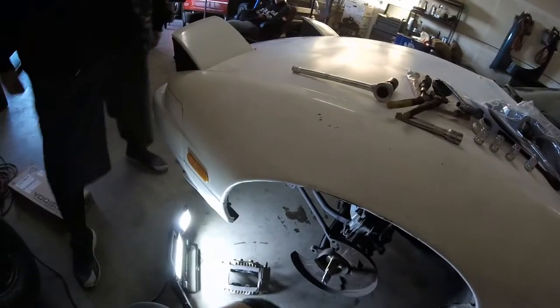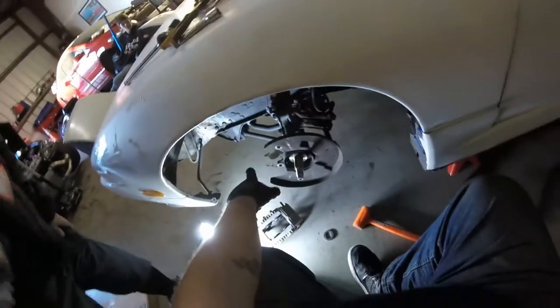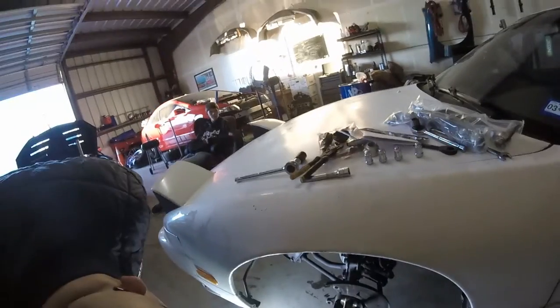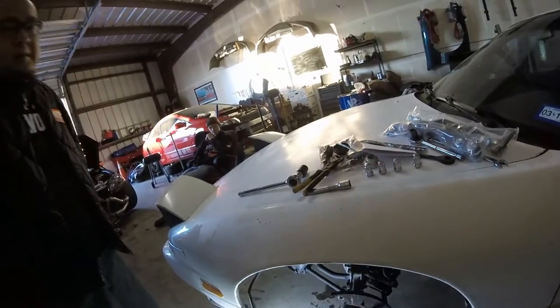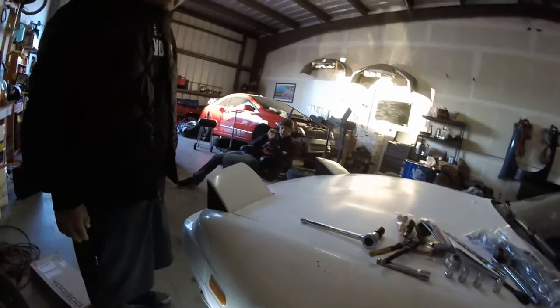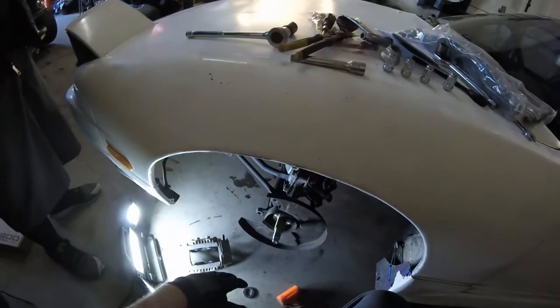Made out, man. Let's get this five lug on and stab those on. Yeah, those are way blown out. Like they're just like rubber chunks. What? On the arms, the old ones. Oh, see them down there? Yeah. So. Did you see what the problem was in the back? I haven't looked at it. It's just all those old bushings. Oh, and also it could be the sway bar too, because there's no bushings on the sway bar.